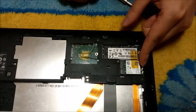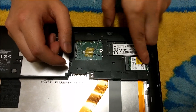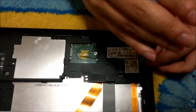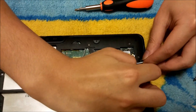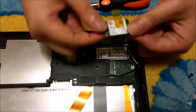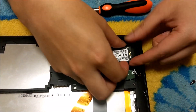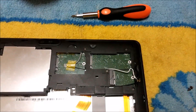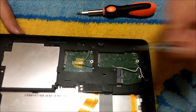So we're going to remove the antennas on the wireless card and remove the one screw holding it down. Just need to tilt it up slightly and take it out — it'll come off. This just shows you that the hard drive fits in the other slot as well.